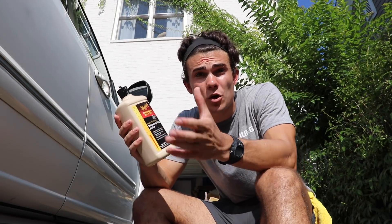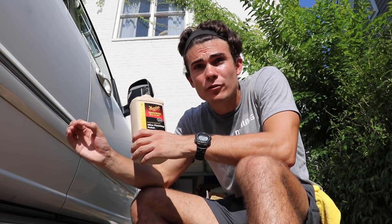You could apply wax to this paint but what ends up happening is you see all these streaks and it really looks terrible with absolutely no shine, because wax is made to sit on top of clear coat and shine the clear coat. So how do we fix this problem? It's going to take some obvious polishing because you're going to have to abrade the paint at a level in order to get the gloss back.